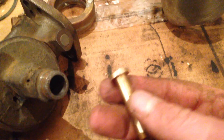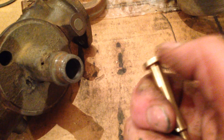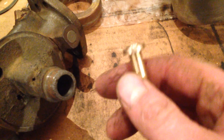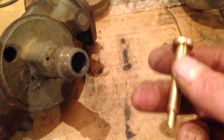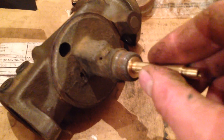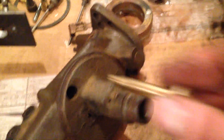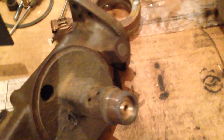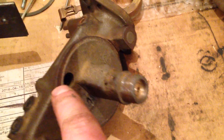I then had to do a bit of work on the nozzle — I machined the old boss off the end, got another piece of brass and put a new boss on slightly bigger, then machined it down to fit as a nice interference fit. The idea is that when you push it back in it'll all be nice and tight again up inside the carburetor.